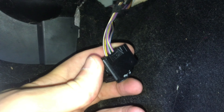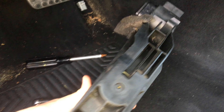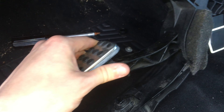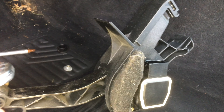There's a connector right there with two prongs on both sides — just pull them out and it comes up pretty easy. I was watching an S-class video and it's the same throttle pedal, but the S-class has a separate plug for the kickdown switch. On mine, I'm guessing the throttle position sensor controls both functions in one plug instead of having two separate plugs.